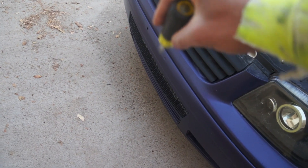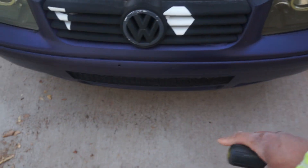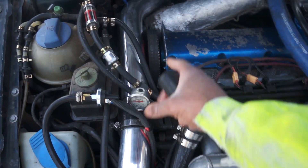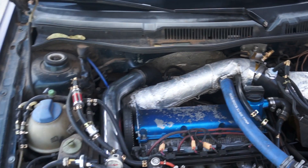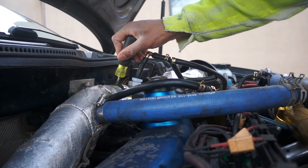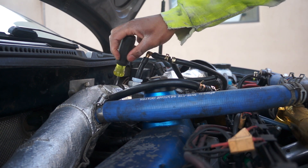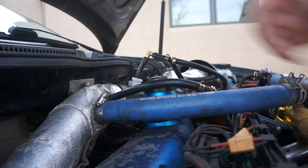I also checked at the intercooler. A big concern is that it's going to start pooling up, which is definitely a possibility, but if you're spraying little enough you won't run into that issue. I never had anything pool up at the bottom or any residue in the intercooler. The only place I was finding blue dye was between some of the couplers and at the inlet of the turbo. Don't laugh at how ghetto this is, but it works. It probably is a restriction, but I haven't had anything get sucked into the turbo yet, so we're chilling.